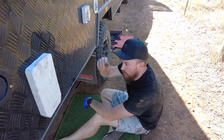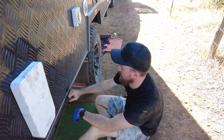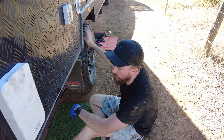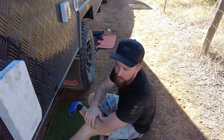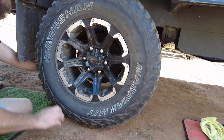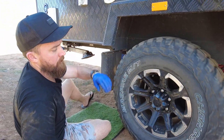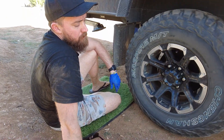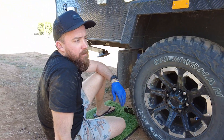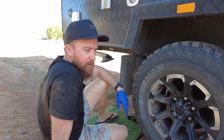The other thing I do is have a look at all the nuts and bolts while I'm under there. I haven't fully jacked it up yet — just got pressure on it. I'll keep my body outside in case something collapses, because even with the wheel still on there are springs and shockies and I don't want to get the brunt. Just enough to freely spin and manoeuvre the wheel. A good thing you can do too is check the handbrake — put it on and make sure the wheel locks, just so you know everything's tight and working.